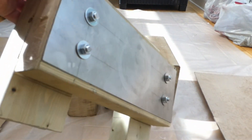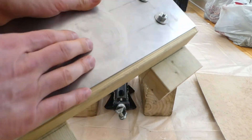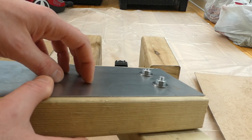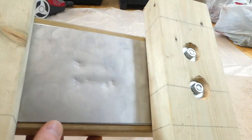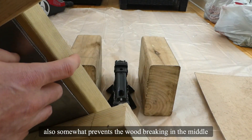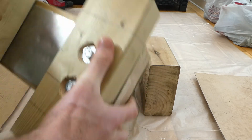First of all, it's not really my idea. The original idea — I've put a link in the description of my video — so I just made a very slight modification. I added a one millimeter steel plank at the top to spread the load and to stop the wood being damaged from raising the car. From underneath I've put two steel plates, one millimeter each, so the jack doesn't cut into the wood. It's fairly cheap but it's really useful. I've used it several times so far.